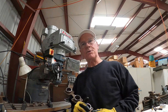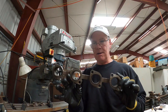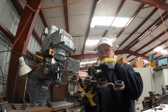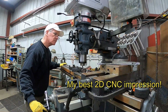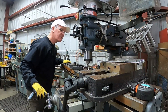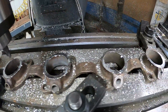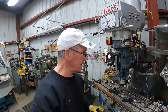Here we are at the secret undisclosed shop with all the big tools. We needed the mill today because, having lopped the exhaust flange off of the Ferrari header, we now need to deck each of these to the same height. All right, that's one and done. We're going to come back and do the next one, and this stage will be finished.